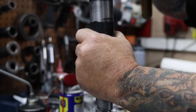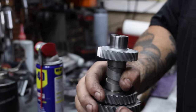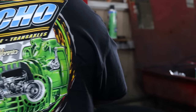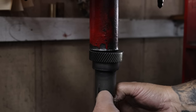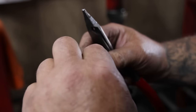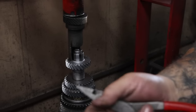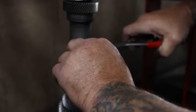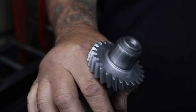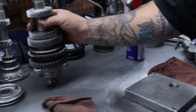Take our spring for fourth gear, check fourth gear — make sure it's clean, no marks in the teeth, no wear. It's a nice good German 89 fourth gear. Take our bearing race, give it a nice polish. I love all the attention — but knowing you do this for everybody, every transmission. Now we're going to put this in the press. Make sure the bevel on these clips is facing upwards so it clips on the inside and doesn't pop off.